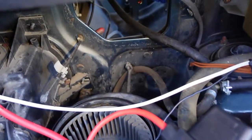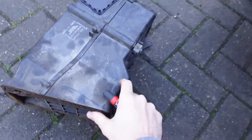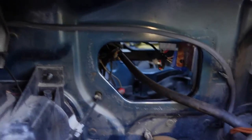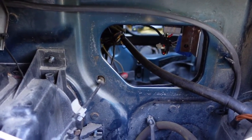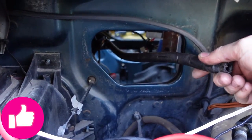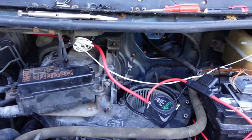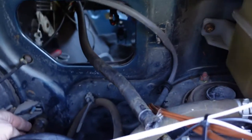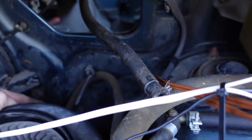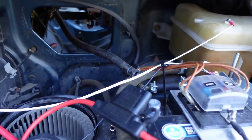So here we have the top of the engine. I took off the box here — that's the bit that goes inside the car and sits on top of the fan. I took that off not necessarily to get to anything in there, but because they've routed a return valve from the coolant bleed pipe — they've fed a T-piece in and it went through that box. So I had to take it out mainly to access the two pipes for the heater matrix themselves, which are located just down there. Really all you have to do is take off that bit of box to make it easier to get onto the clamps.